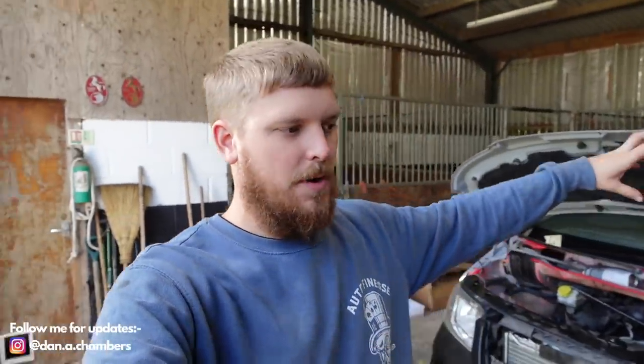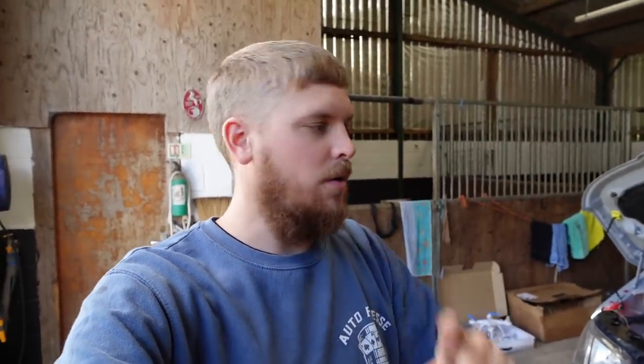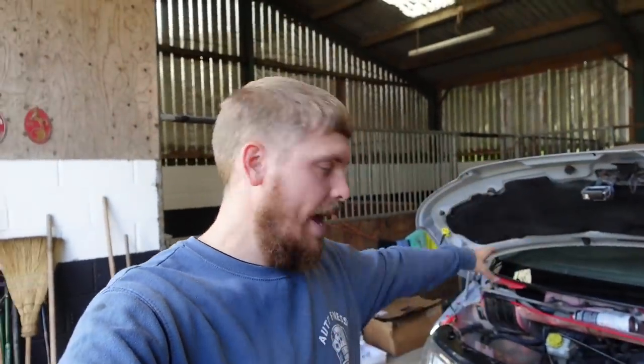So, if you've been following the channel for a while, you've seen that we've had a bit of a problem with the coolant system pressurising. Tried everything under the sun to change it and sort the problem out, and we changed a lot of things. Nothing solved it. So, last resort was to take the head off. So, head's been off, and thankfully, or not, it had blown.